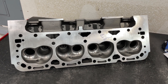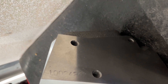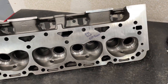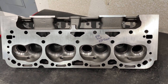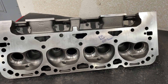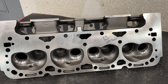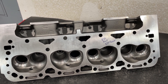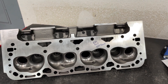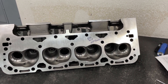This is from Dart — their super stock heads. This is their legal part number: 10024267. There are two different versions: one's a 194 valve and this one's a 202. They have 76cc chambers. This certain class requires you to run this head. This head isn't going to make a lot of power — it makes small block Chevys look horrible. But that's what they require. As far as economical goes, it's actually a pretty cheap head, which kind of shocked me. Usually when classes require a spec head, it costs too much or they give no discounts to dealers.